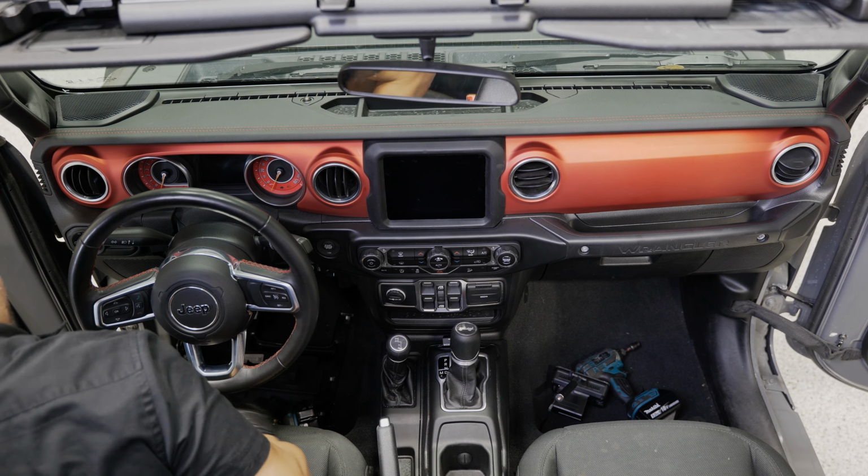And there's a little piece of foam stuffed next to the tweeter. I want to pop that little foam out, because most of the time it'll just fall right out when you pull the speaker out. Stuff the batting into the woofer housing, the woofer's enclosure. Stuff that foam back into the opening there, and that's pretty much all she wrote for back here. We'll put the grill back on and then we'll do the same thing on the other side.